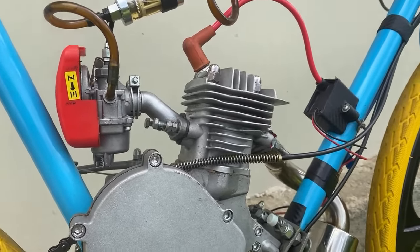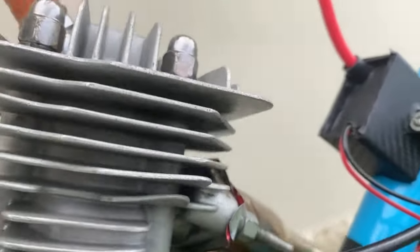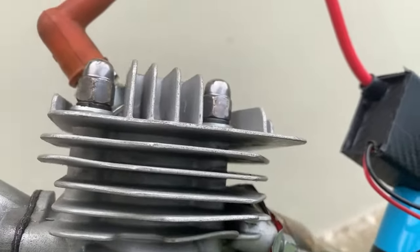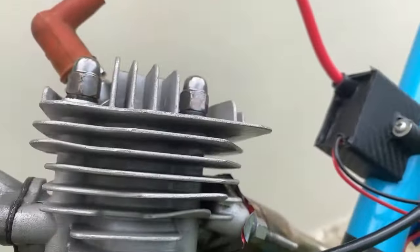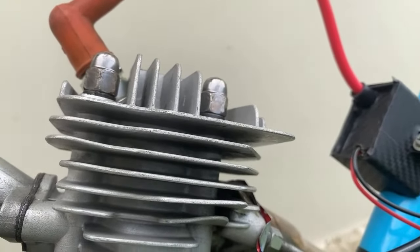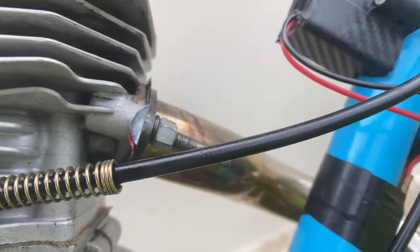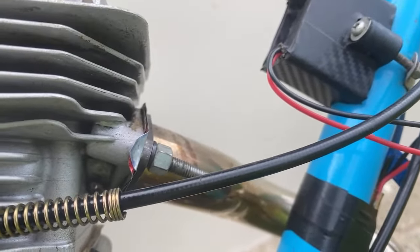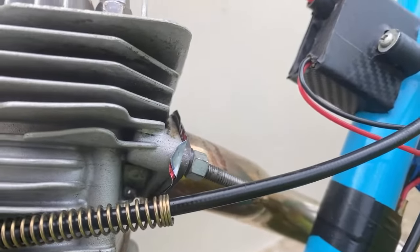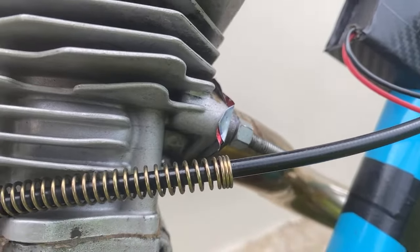Don't put no gasket maker there. Over here, when you guys got the same cut, this one is one piece, but you guys, they have two. Don't put silicone in there either. Use the metal gasket alone, that's it. Over here, if you don't find no gasket, find a can material, and you can do it with that. You use like 10 of them.